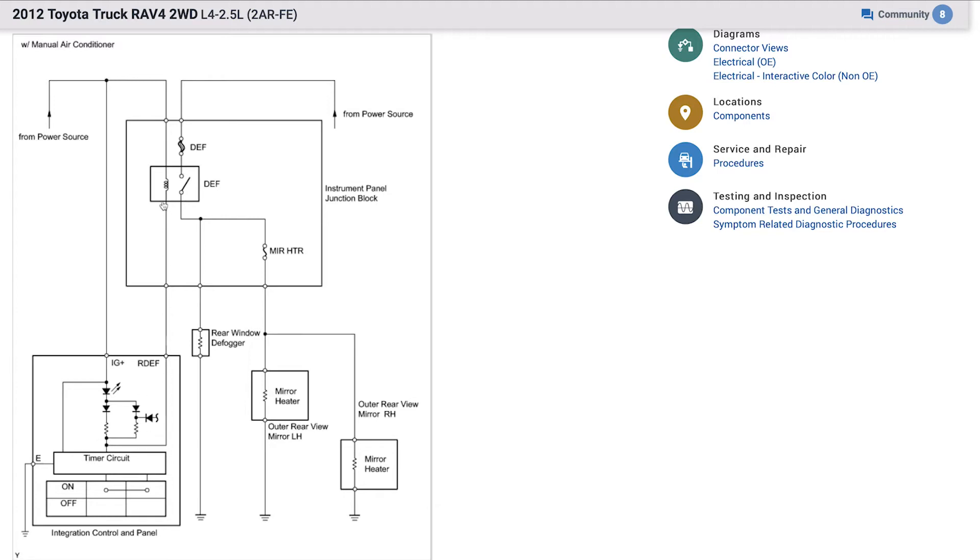When I push that button it turns on a relay — the circuit interacts with the coil side and ground side of the defrost relay. When the relay turns on, current flows through a fuse, through the relay, and there's a secondary fuse just for the mirrors or the rear grid. Three things come off this one circuit in parallel: the rear grid and the two mirrors.